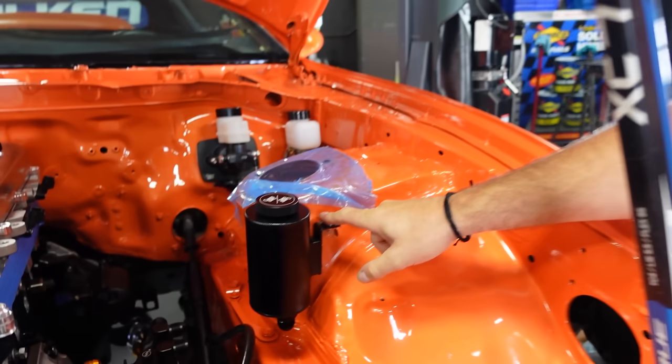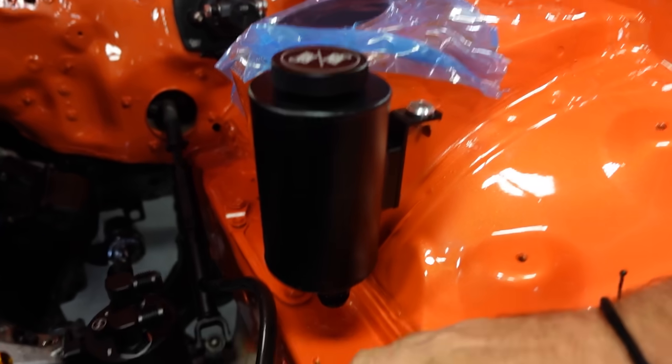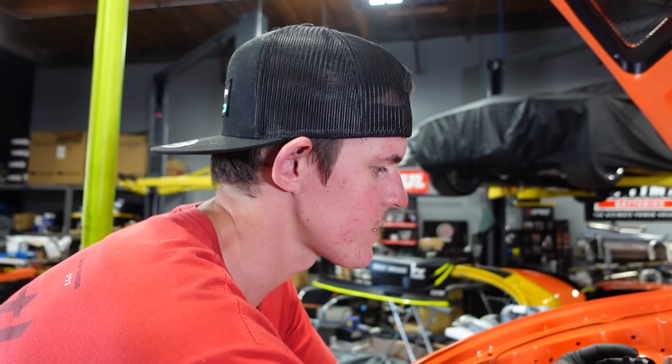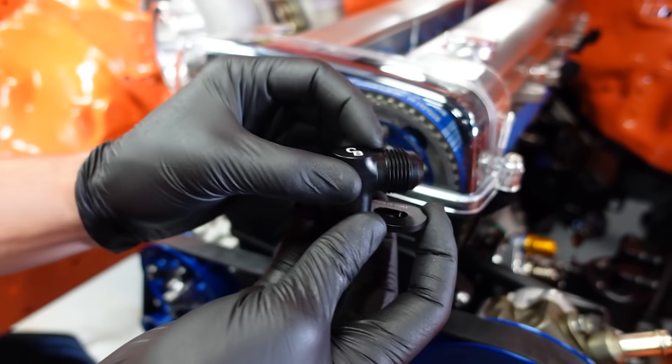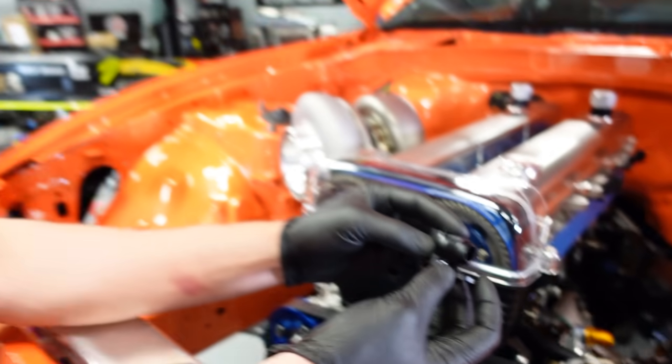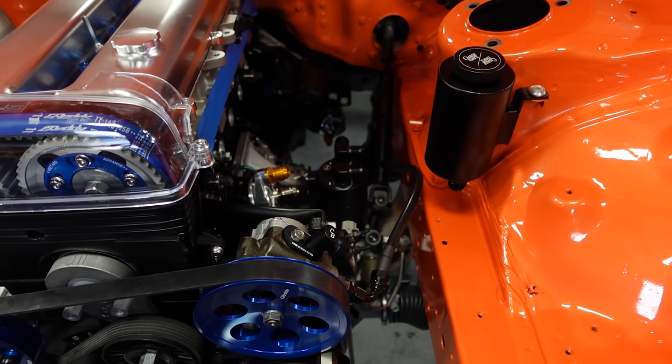The Chase Bays kit came with a really nice bracket. We're using a factory location to mount the power steering reservoir. Clint's working on some of the lines and fittings — it's a really nice close run to our power steering rack, and we've already got our high pressure line in place. Chase Bays has a cool feed fitting for the power steering that replaces the factory barb with an AN fitting that rotates inside, so we can orient it however we want and choose how our lines look. My goal is to set up pretty much all of the fittings and get everything in location before Dime comes over. I'm also going to drop our intake manifold on, get our fuel rail in place, and start tackling things like our fuel pressure regulator and fuel damper kit.